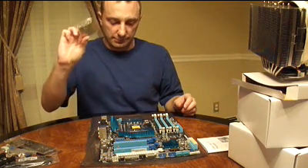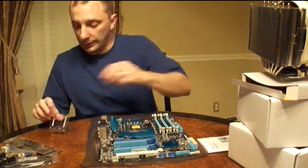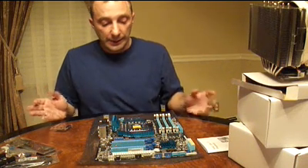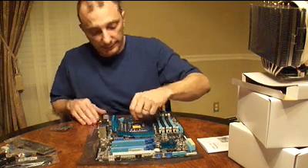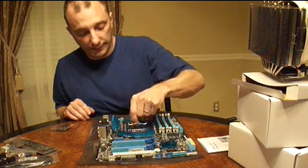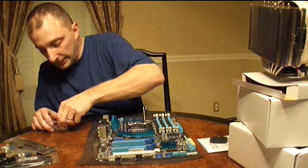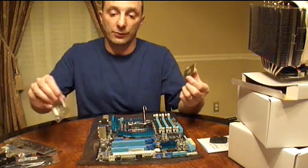The chip is this big. When you're handling it, handle it from the side. Don't touch any of the ICs anywhere on any of these pieces to avoid damaging them. The chip is fairly easy to install — just follow the instructions that come with it for this particular motherboard and chip. I'm going to push this little locking lever down to release it, then lift this plate up. The motherboard comes with a protective cap over the area where the CPU is going to go in. Keep this because if you have to mail the motherboard back, they do want this on top of the socket area. The CPU can only go in one way — unless you force it, and if you're forcing it, you're doing something wrong, so don't force it.